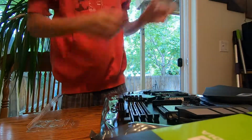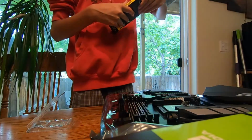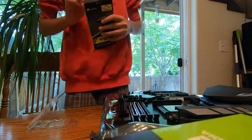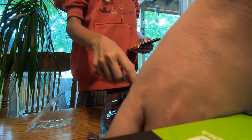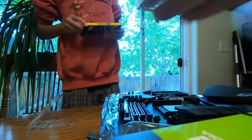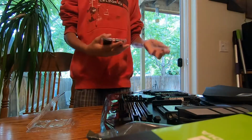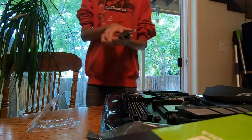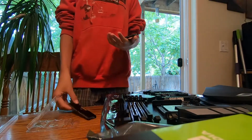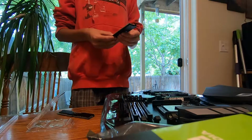Oh, RAM, the fun part. You're making me worry. You're not gonna like this. We said to refer to the manual. So this one and two, then this one, right? Yeah. Why is RAM so fun? Rick, I'm worried. Because everyone surprises themselves the first time they put RAM into a motherboard. You gotta press harder than you think, and it makes a loud pop.